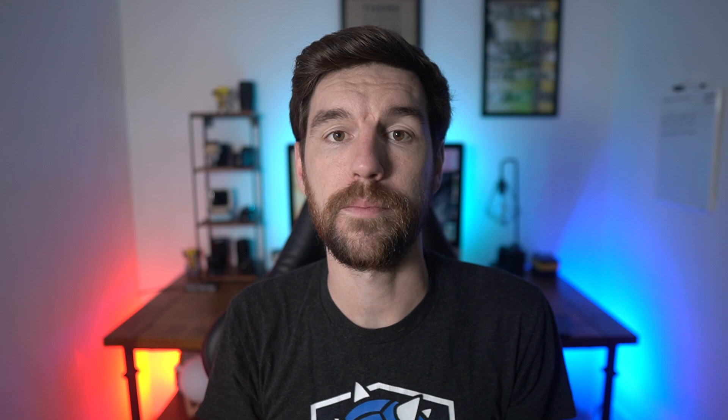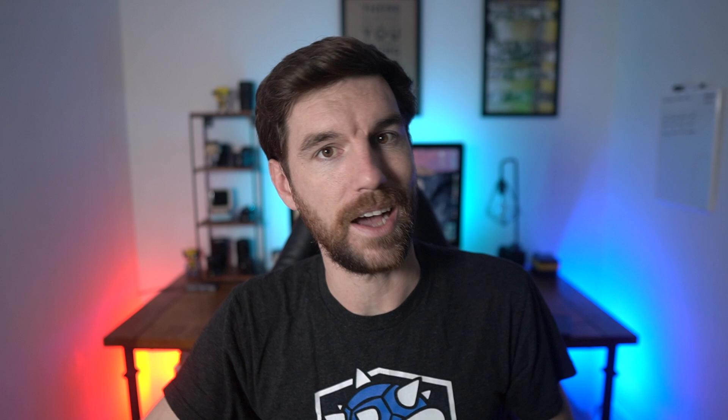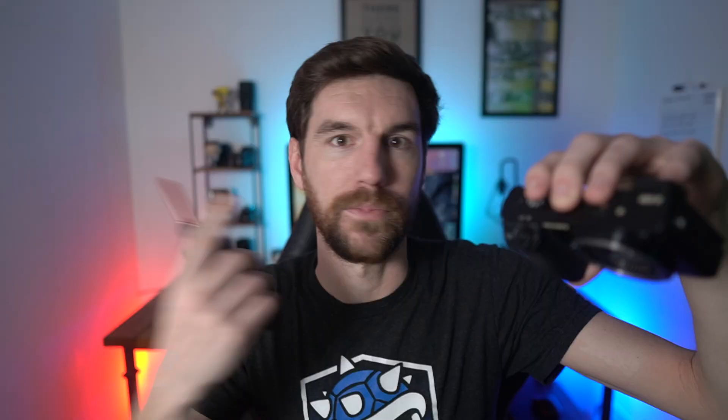So we're going to take that off. A rule of thumb is whenever you do have the sensor exposed, you want to have it pointed down. So if you're switching a lens out in the field, have your camera pointed down and use the white dot indicator to get your lens on. With the blower, we're going to point the camera down and simply blow in. This is just hand-powered air compression — this isn't canned air. Never use canned air on your sensor as it has moisture, where this is really just dry air. Never use your mouth. Don't blow on the sensor like an old Nintendo cartridge.